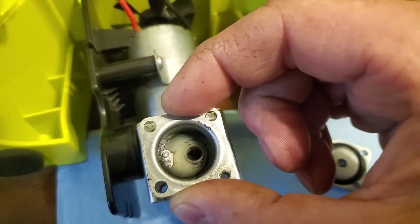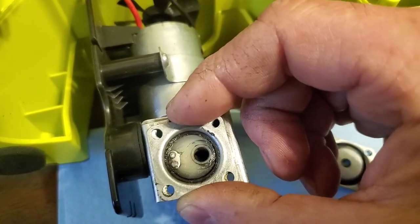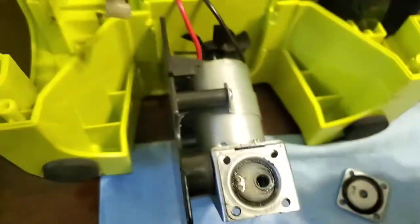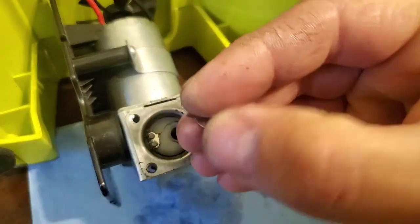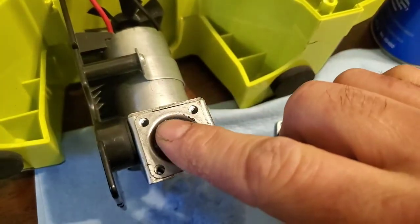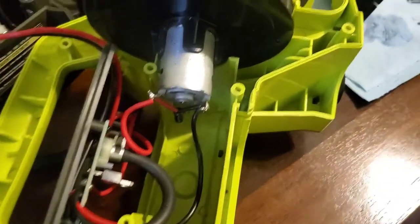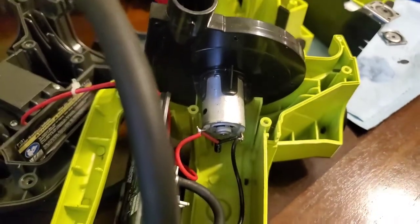It's preset, you know, when the piston goes down, it would suck in air. And then when it comes up, of course that makes your compression. So that's what's wrong with this little guy, is this little bitty flap or reed valve. It goes right there. Broke. Interesting.